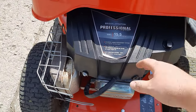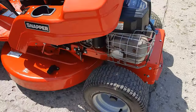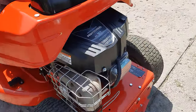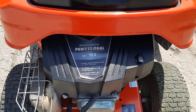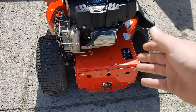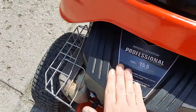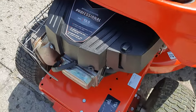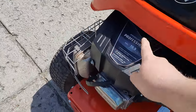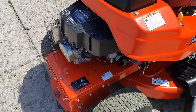When I got it, the top cover was off, valve cover was off, and I couldn't start it. I looked on Briggs & Stratton's website — about a hundred bucks, maybe a little more, for a new cam. I didn't want to buy a hundred dollar cam and then find out the transmission was messed up too. So I went on Amazon and bought an aftermarket one. It was like 35 bucks. It came with the cam, the tappets, a new valve cover gasket, a new sump gasket, and two crank seals — all that for 35 bucks.